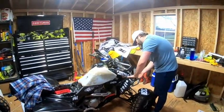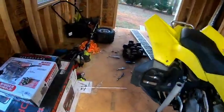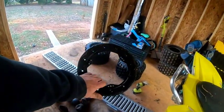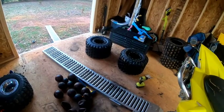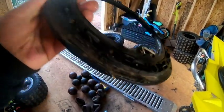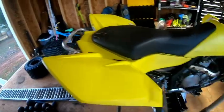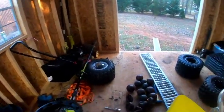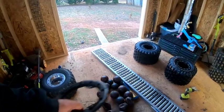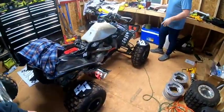All right guys, we're still here at about 5:45-6 o'clock. Jamie is getting his graphics on — they're looking really good. The generator is still sitting here. So what happened with the wheels is in just one ring they had five stripped bolts. They just took the impact gun and went as hard as they could, stripped the bolts, and made sure it held air. I figured out why — they didn't clean the rings, so there was dirt and grime in there where they tried to seal it. I counted 11 or 12 stripped bolts total between just the rear two sides for both wheels.